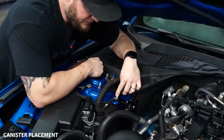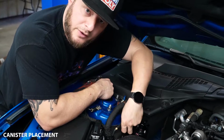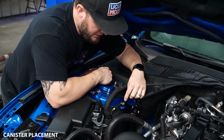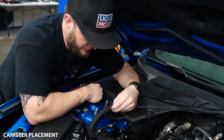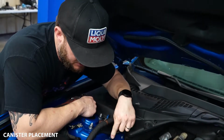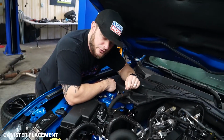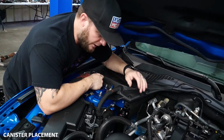Okay, so in this instance, the bolt isn't quite long enough to go all the way through the factory nutsert on the bottom. So you don't even have to re-secure the bottom section there. In the event that this doesn't work for you, we have used just the factory 8mm with no issues whatsoever as well. But either way, this is good. So we went in from the top in this instance, used the washer. There isn't enough protruding on the bottom to use the washer and the nut, and it is fastened tightly. So you're gonna be good to go either way.